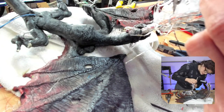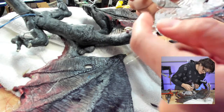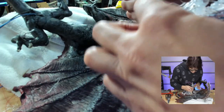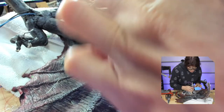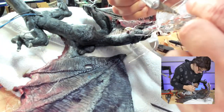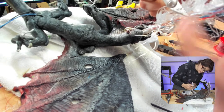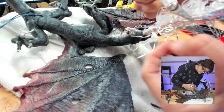And all I'm trying to do here, as I fail miserably, is just move the little glue things out of the way. There we go. Just going to twist the wires. And you guys can't see anything, I get that. And before anything, I'm going to go ahead and solder. Because now we're getting to kind of the land of bare wire, I'm going to put a little bit of insulation on that before it starts tapping into this hot mess right here. So we have quite a few to tap into.